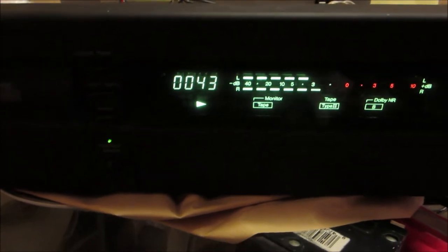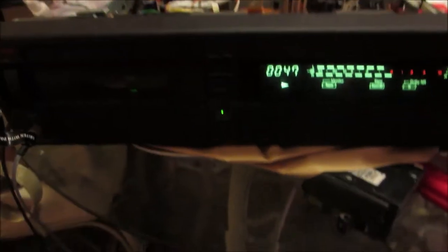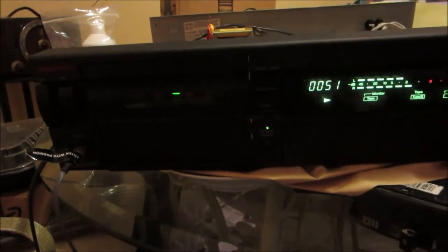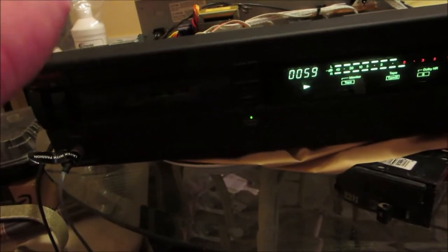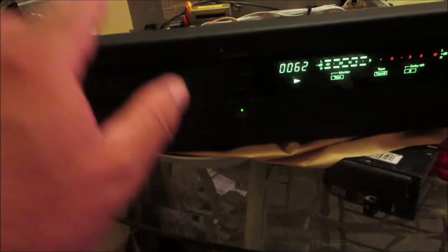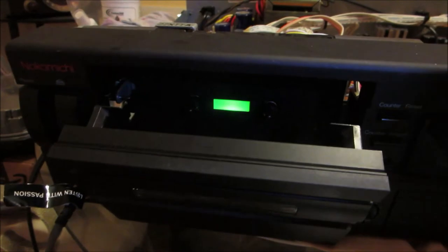Let me get my headphones and test this — looks like it's working fine and I can hear it through my headphones. Perfect, we got it fixed up. The problem I was having: it was fast-forwarding and rewinding but it wouldn't play — the mechanism would lift and then immediately go down after about one second. I noticed the capstan wasn't turning, so I knew something was wrong with the belt. I opened it and it was very loose. Now they're both turning because the belt is moving the capstan. That's how I confirmed it was the belt.